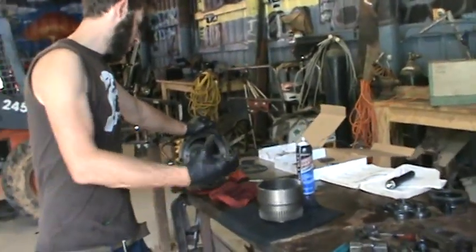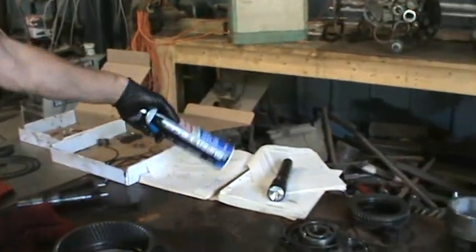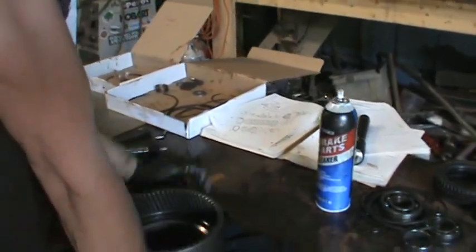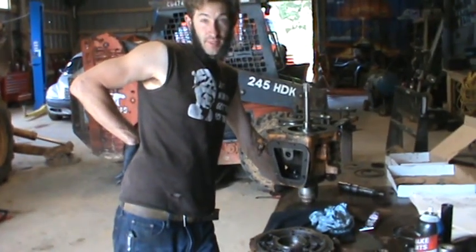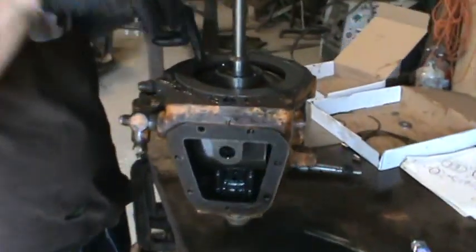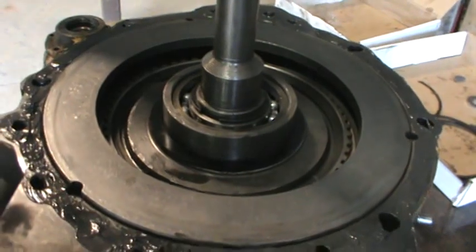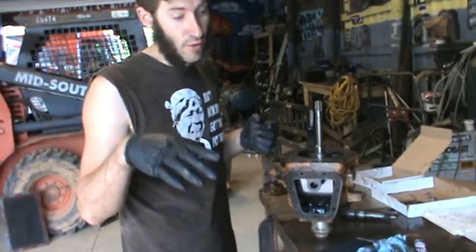Anyway, I'm going to put it back together. I'm going to slide this whole hub assembly back into the back of the transmission. I've already got new seals in here. And if you have a parts manual — this isn't even a shop manual, it just shows you what parts you could order from Case — it's just good to have when you're putting it back together. Make sure you replace the bearings and the little seals and retainers. So now it's ready to button back up. We've got the charge pump front. There's new O-rings. The shitty kit I got didn't come with gaskets — I don't know why on earth they would skimp on a gasket that costs a penny. This is all the reverse clutches — there's only three or four reverse clutches, because you don't usually push dirt backwards in reverse. Four clutches in reverse versus seven or eight forward clutches — that tells you the forward is stronger than reverse.